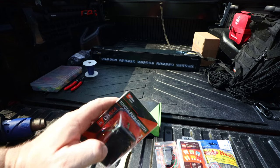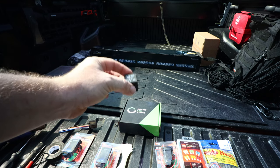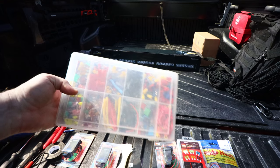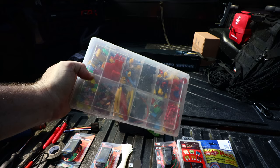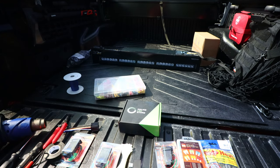We have a set of fuses. These switches are rated for only three amps so I will be using a three amp fuse to power these switches. These switches basically just send a signal to a relay, and once the relay is told to turn on, the relay is in charge of sending the actual power to your electrical accessory. Here we have some wire splitters and crimpers, an assortment of various electrical connections, and a roll of 18 gauge wire. Now that I've gone over all of the tools and equipment, let's go ahead and start taking everything apart and wiring everything up.